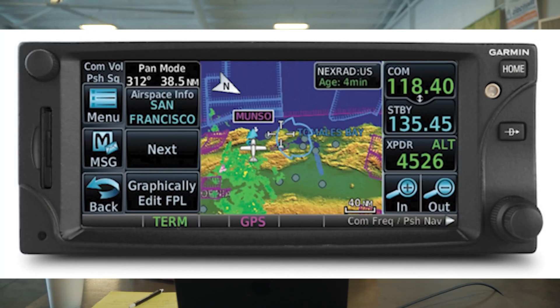Option one also includes a GTN 650 TXI — that is a GPS, nav radio, and comm radio. It has a display with traffic and weather, and it can also control your transponder. This is an awesome unit and it's a step up from the GNX 375 we talked about before. You're also going to want at least a second comm radio, and at this level you'd probably want a redundant nav radio as well. So I've included the GNC 215 — a comm and nav radio. Now with the GTN 650 and the GNC 215, you have two comm radios, two nav radios, and one GPS with a moving map and display.